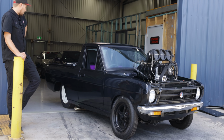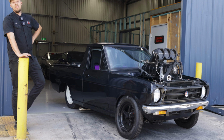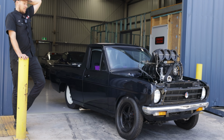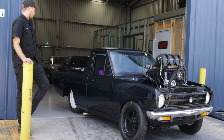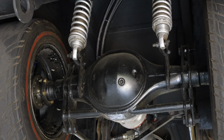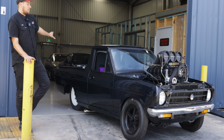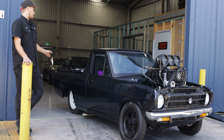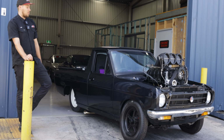The only thing that we're sort of taking away from that, not that it's a negative, everything went great, is that we want more wheel speed, because 1,000 horsepower is just spinning those things to limiter without even trying. So we want to get some higher diff gears in the back, get some more wheel speed so that we're not just banging this thing off the limiter. That's the only thing that was a drawback, which it still wasn't because it was sick.